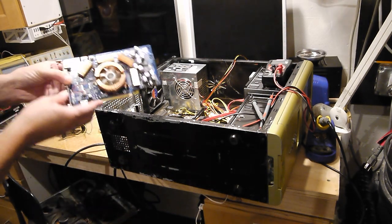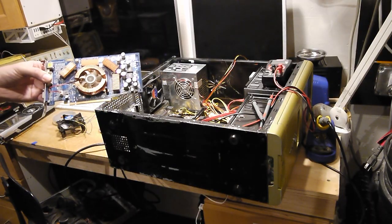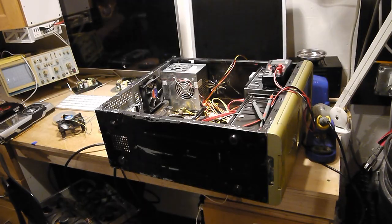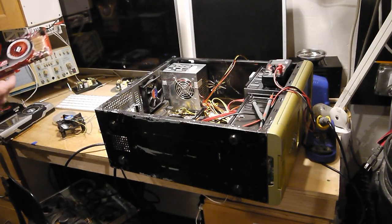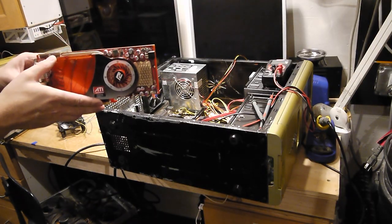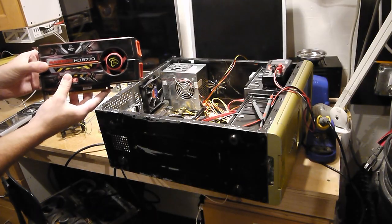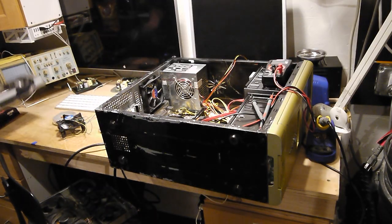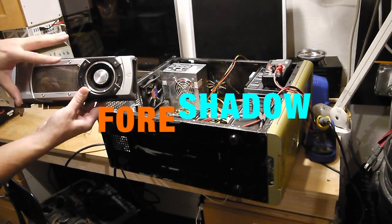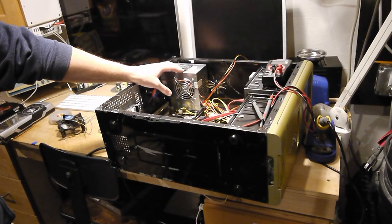Originally I had a GeForce 6800 video card in here. It ran okay up until we upgraded to Windows 10, and Windows 10 does not like this video card. So the three cards we've got to choose from: a Radeon 4850, a 5770, or an NVIDIA GTX 770. The GTX 770 is the one I'm hoping is going to work, but it also draws 230 watts, so I need to make sure we don't overdo it on one of the rails.